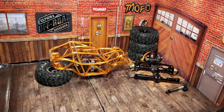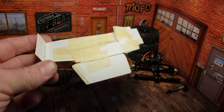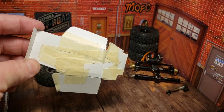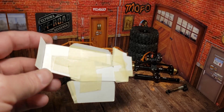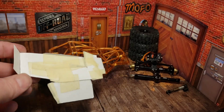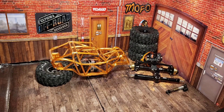When I build a bouncer chassis, I like it to look super clean. This is going to be a one-piece interior. I'm going to cut that out of a piece of Lexan, paint the back side of it, and it's going to look super smooth. I'm going to get it folded up and stuck in the cage — you won't see anything I don't want you to see, and it's going to be super lightweight. I'll be able to vertically side-mount the battery very low, so this will have a really low CG.